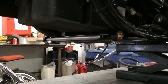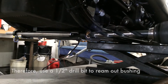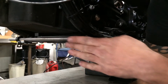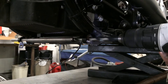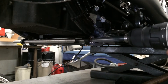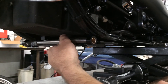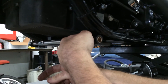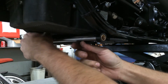The shaft size in this application is half-inch and we can use a half-inch drill to do the same thing as reaming this bushing. Reaming means we're going to be removing material to improve the fit. When we had the shaft in here it was going at an upward angle, so we're going to try to ream this in a more downward direction. What's optimal is to have your bit running at a higher speed and just lift up on there — you can see the material being removed from the bushing. You're not hurting anything by doing that.